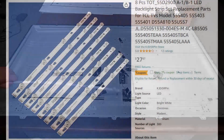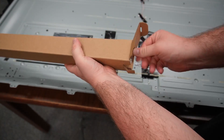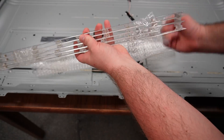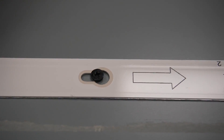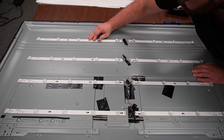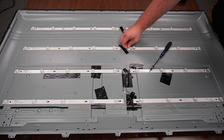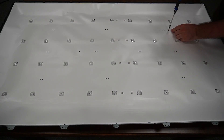Now it's time to go shopping. I found a suitable replacement part on Amazon for about $30. Similar light sets may sell even cheaper depending on your television's model. It has the model numbers listed in the product description, so I'm pretty confident these are the parts I need — I'll have a link in the video description. The new lights seem to fit perfectly in place, locking back in just like the old ones did. After making sure all the new backlights are plugged in, it's time to start reassembling the TV. I'll be leaving the assembly in this video so you can see all the steps in the correct order, just sped up by a whole lot.